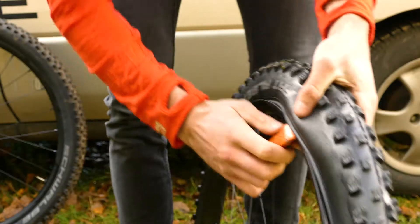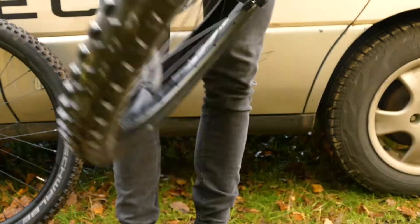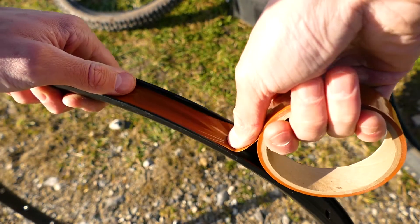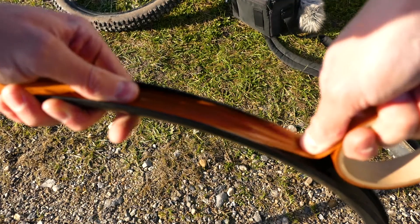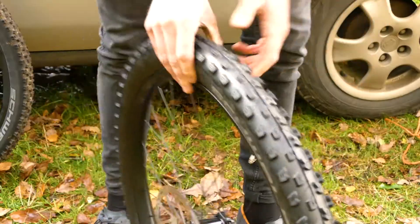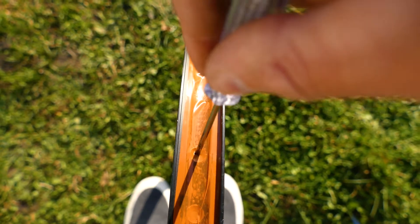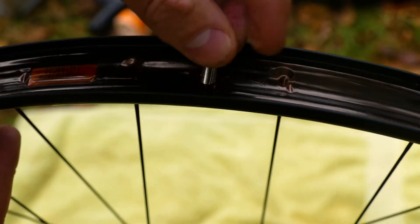What you're going to do is take your wheel, get off the old tire, and take the tube out — maybe save the tube for later rides. As you can see, my rims are already set up with tubeless tape. If your rims are not, make sure the rim is nice and clean and try to stretch the tape a bit to make it sit better. If your tires sit pretty loose on your rim, you can give it an extra round or two of tubeless tape so the tire sits tighter and you won't burp as much.